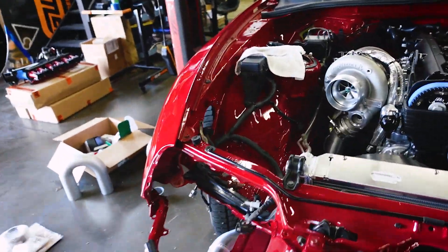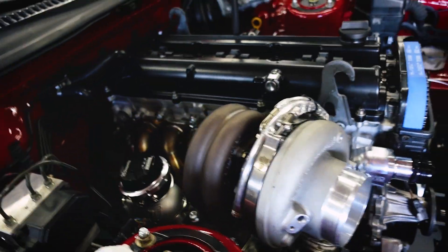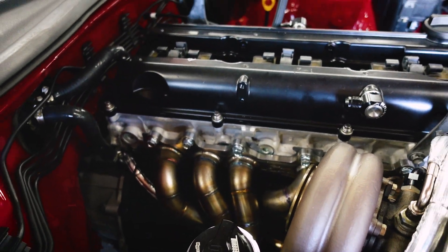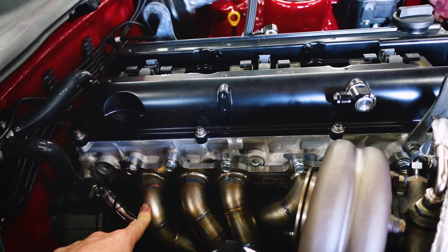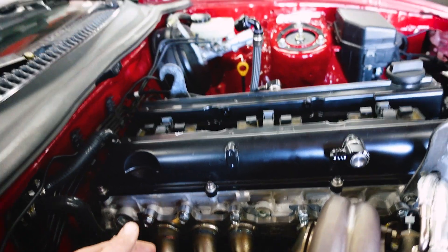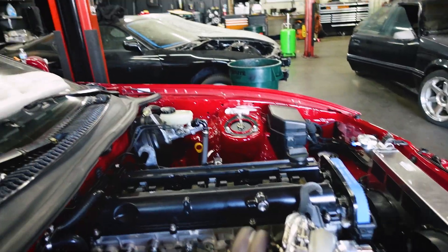We've mounted the ETS intercooler and Mark has been building intercooler piping that's coming out really clean. He has the Powerhouse Racing S23 exhaust manifold with one-and-a-quarter inch primaries. The reason we want the smaller ones is volumetric efficiency - if you have bigger ported heads, bigger exhaust runners, and bigger intake, all of that takes longer to fill with boost. You might make more top end but you lose spool and response. So we're going the other direction to keep everything reasonably sized for quicker spool and response when on and off the gas.